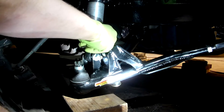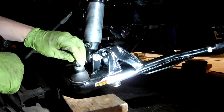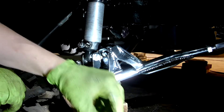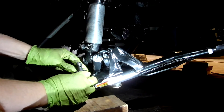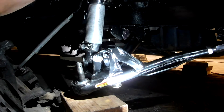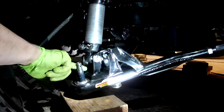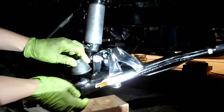Make sure your coilover adjusters are facing out — that's important for adjusting your shocks. On the lower ball joint, you have the castle nut and then another spacer, which goes on top of the spindle — that's important for alignment of your spindle. I'm a little paranoid, so I take off the boot and put a little grease on the mounting surface for the lower ball joint, because if you ever had one frozen on, it can be a nightmare. I broke two different ball joint removal tools before I finally got it off during disassembly. So just a little grease, a little added insurance, then get your rubber boot back on.